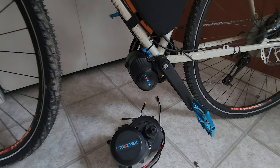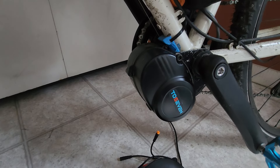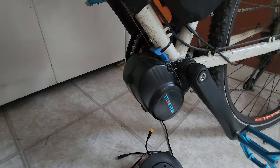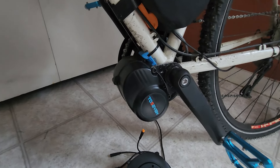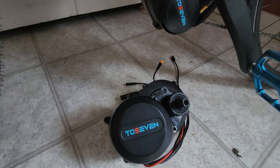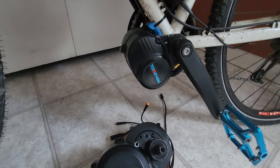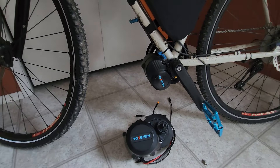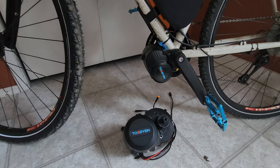I just want to make it clear that this is a tiny motor. It has a sweet spot of 500 watts continuous stock, and it will run at 500 watts continuous — it's done this in some pretty hot places like Australia, as well as during the summer months here in Canada. You can see the DMO1 here, which is the bigger brother, and the DMO2 here — it's less than a third the thermal mass of it. But what I wanted to find out was how the motor performed with a more sophisticated controller, and if the addition of an external controller would improve speed and torque over the stock setup.